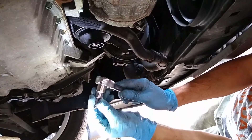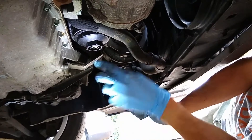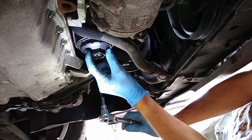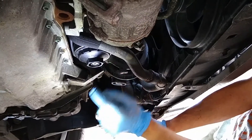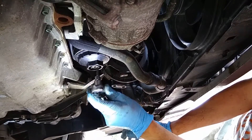There are two parts to this: one is to remove the central plug with a 6mm allen key so that you can drain down the filter — again making sure you have a tray underneath. The next part requires a 36mm socket to remove the whole housing itself. Once that's done we can then replace the oil filter element that sits inside it.